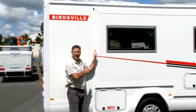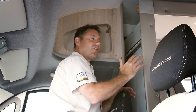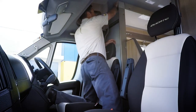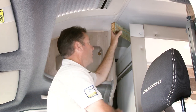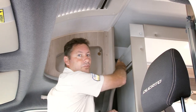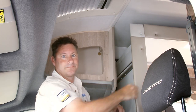And that's how your slide out goes in. Now what we've got to do is secure it for travel. Now that the slide out's been pushed in, we've got to come inside and secure it so that when you're traveling the slide out won't go out, because those motors are now disengaged. There's a piece of 4x2 timber I just grabbed from the workshop, but wherever you're camping, all you've got to do is pack the space between the back of this frame and the wall of the motorhome. Once that's in at both ends, you're ready to go.